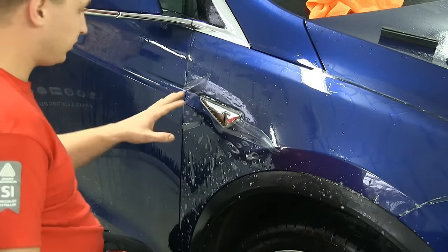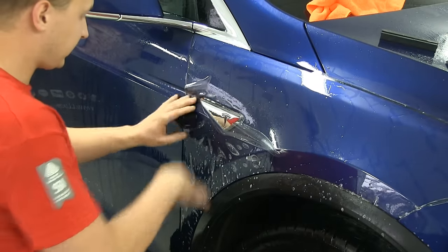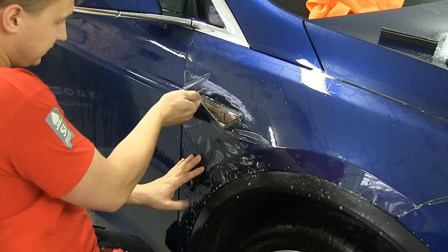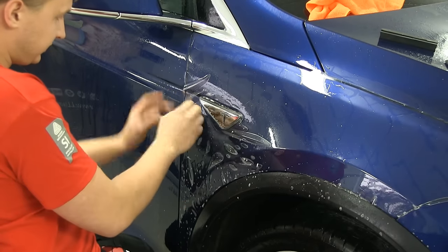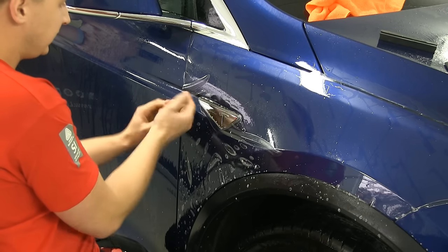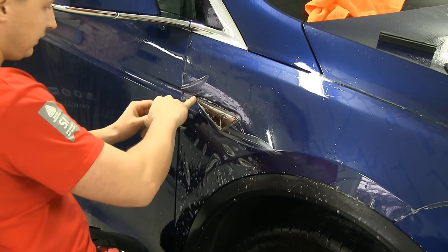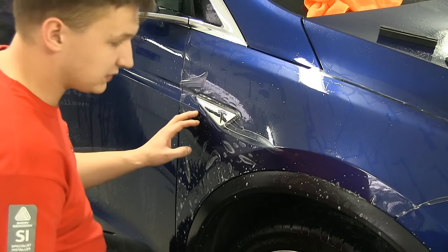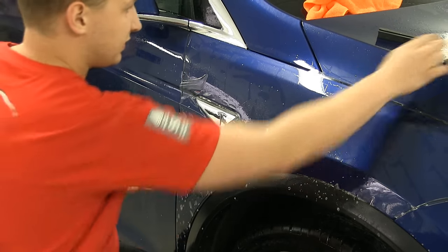After trying to find the right spot and the right place for this material, sometimes it's really too hard to make something here, even if it dries out, it doesn't stick. What you can always do is make a symmetrical relief cut so the material relaxes here, and then you can squeeze it there and there. In this case, the relief cut will be in this place, so basically it's not visible and you can join them as close together.